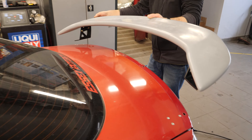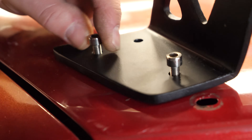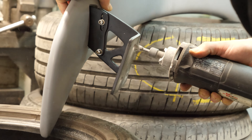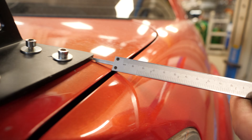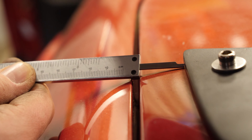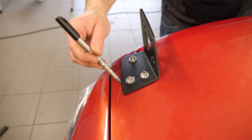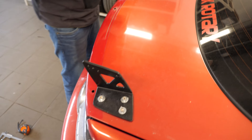With the holes now ready, we can position the spoiler that's attached to the brackets, screwing the bolts just a bit to see how well they sit and if the spoiler has the same distance on both sides. After the measurements were taken, we had to enlarge a couple of holes to make the bolts sit in perfectly. With the spoiler repositioned, we can see that the distance between the boot edge and the brackets is about 2.4 centimeters on each side — the same on both. Now we have to mount the lower spoiler to measure the sides so that they are equally distant. Everything fits perfectly, so we have to mark the exact position of the brackets by tracing a line around them with a marker.